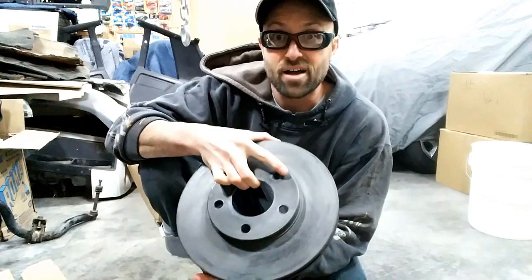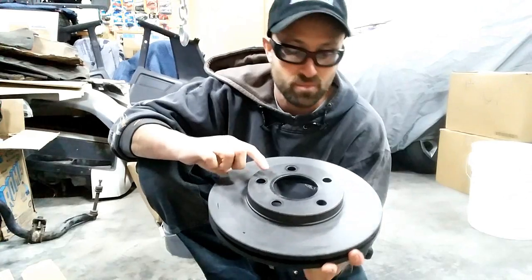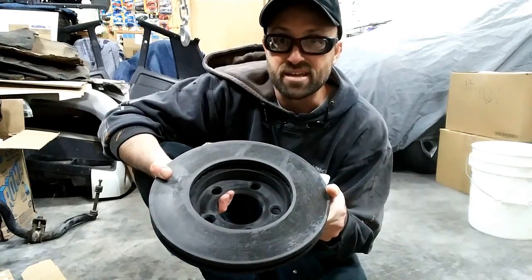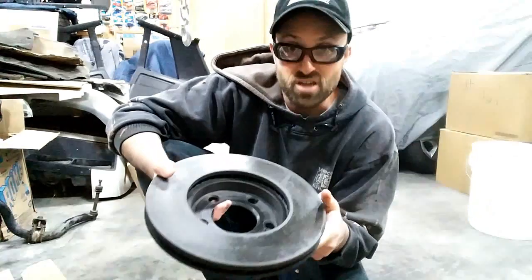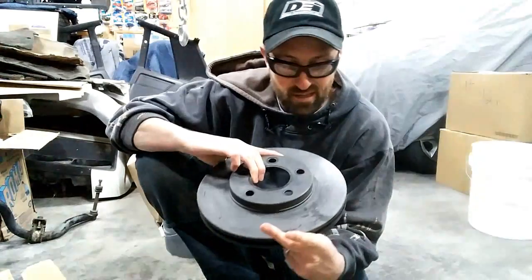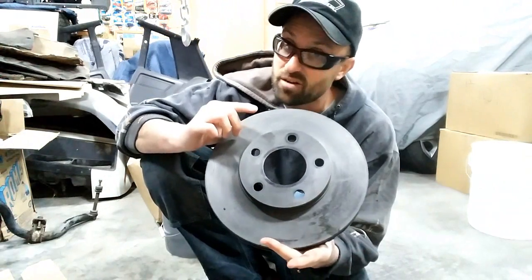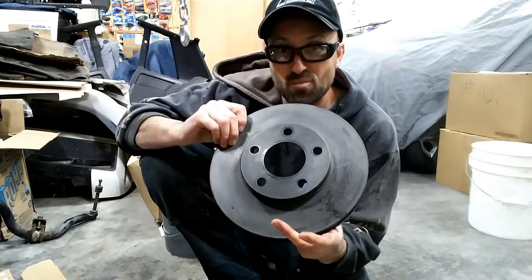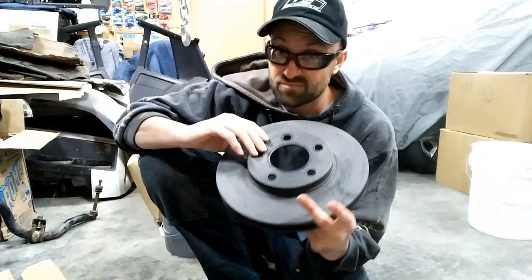Here's the finished product after allowing it to drip dry — a very good, clean surface. Remember I'm going to paint these, so I'm just going to scuff them, etch prime them, paint them, and get them to a nice black surface. You may want to take these in and have them turned if you want a better contact patch for your pads, and you can check your pads or get some new ones at the same time. These are ready to go on the car after they're dry, and you can always just leave them as a nice gray surface — they are sealed from rusting again so you don't have to worry about them turning back to orange nastiness. That's it for this time from Basin Motorsports; I'll see you next time.